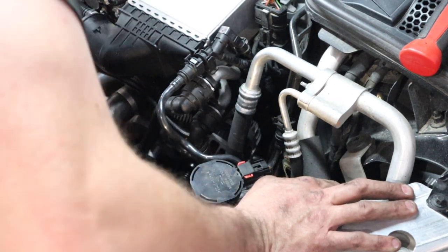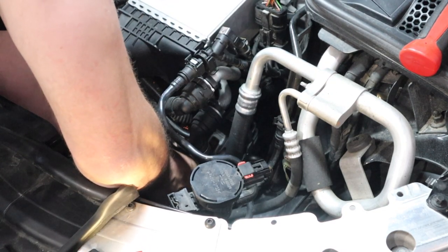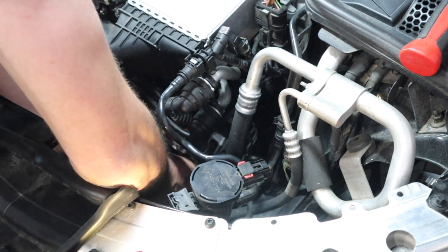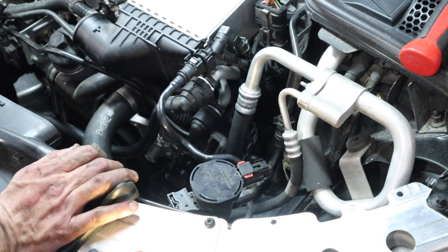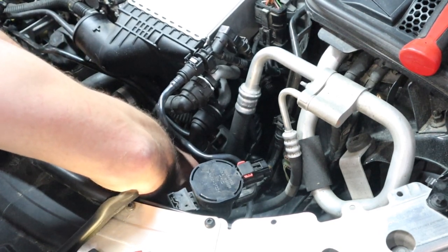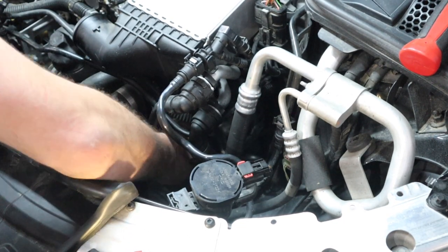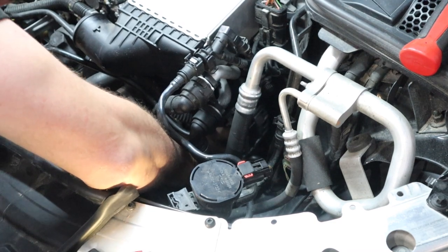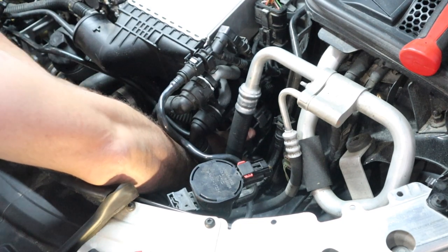Need to make sure that I put the right alternator back in — the alternator on the bench is dirty; this one's clean. Snug it down pretty good — you're not going to be able to get a lot of torque on it, just snug it down good. At this point we're ready to set the alternator in its spot and rotate it down in. I chose to take the idler pulley off just to make it easy. If you don't take the idler pulley off the alternator, you will fight with it being cumbersome when you're trying to bring it out.